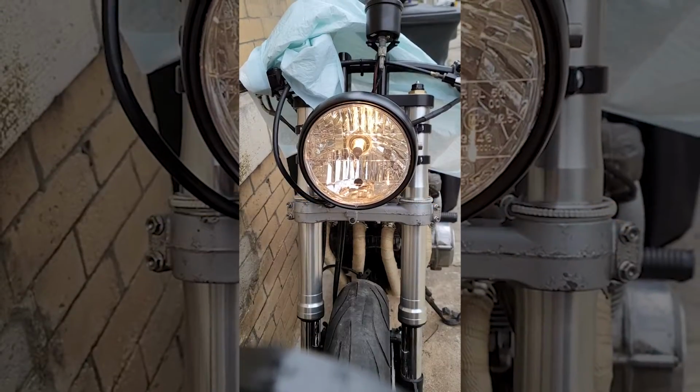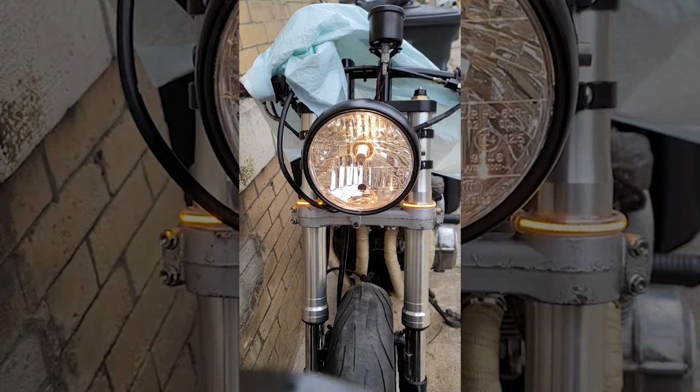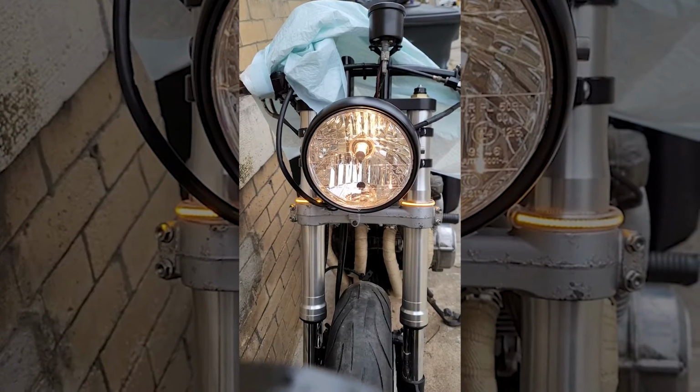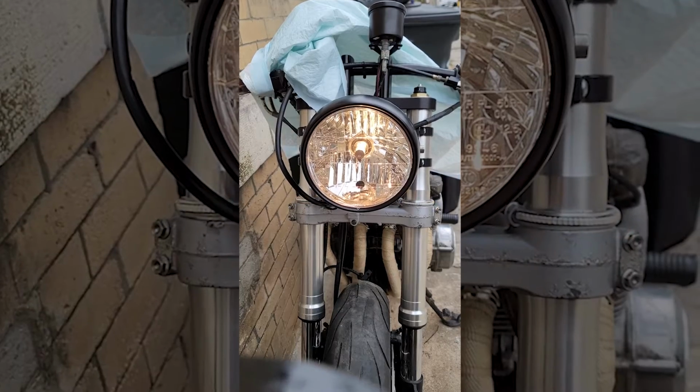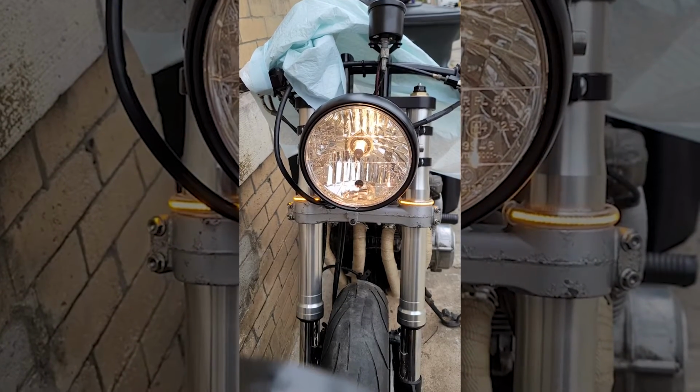Turns out it was the headlight wires, which I had concluded were way too thin of a gauge for the brand new modern bulb. The old sealed beam unit from the 70s was uselessly dull, so I reckon it wasn't really an issue for that light. Again, this bike nearly burned to the ground, so I wasn't going to play around with fire risk.